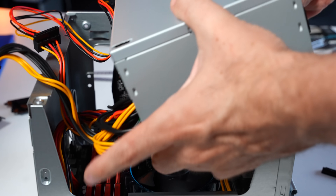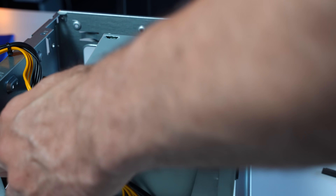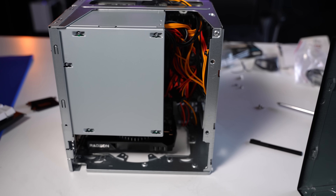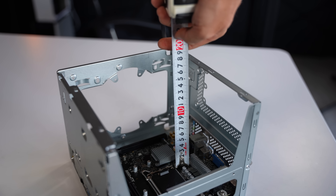Now for the positives: I was surprised by how easy and quickly you can build an ITX rig in this 8-liter form factor. It took me 10 minutes from start to finish — just put the CPU in, RAM in, cooler on, SSD in, graphics card in, wire up the 24-pin and 8-pin, and insert the power supply. The PSU area supports both ATX and SFX power supplies, and if you go SFX, you gain an additional 23.5mm of CPU cooler clearance, bringing it up to around 77mm.